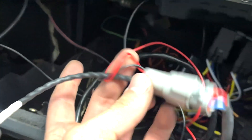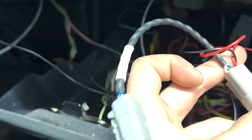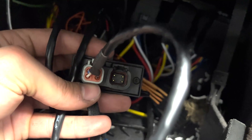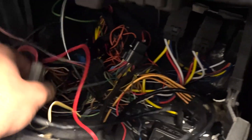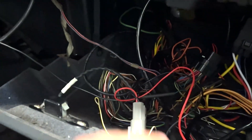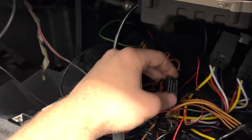So this is our CAN bus wire. We got a power and ground that can power up the ECUs, and then our CAN is actually the blue and the white — so we have CAN high and CAN low. That wire will end up going to our wideband controller, so the wideband controller gets powered by those wires. I'm going to run the other CAN from here over to the IC7 dash. Since I have a 750 Elite, what I need to do is cut these wires off and pin them into the main harness here. There are three of them, but one of them I'm not using.